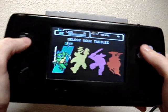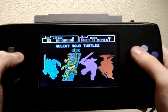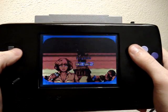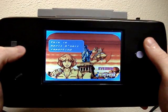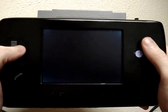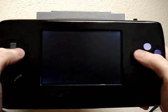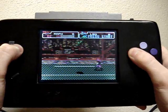You'll notice the corners are lit up a little — you can kind of tell it was LED-modded. To save battery life, rather than using the original backlight I switched it out with four very bright LEDs, supposedly 10,000 millicandela. It's still a little bit dark in person; I think I'm going to do a brightness mod to make it a bit brighter. But for the most part it does its job, and the sound is great.